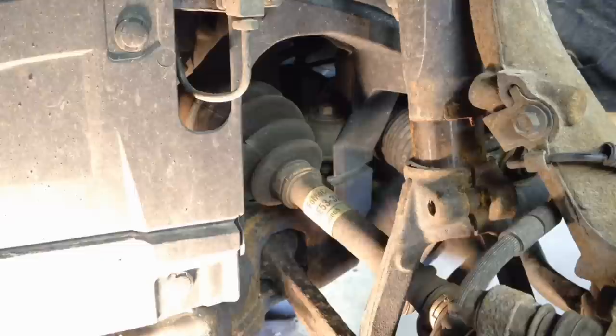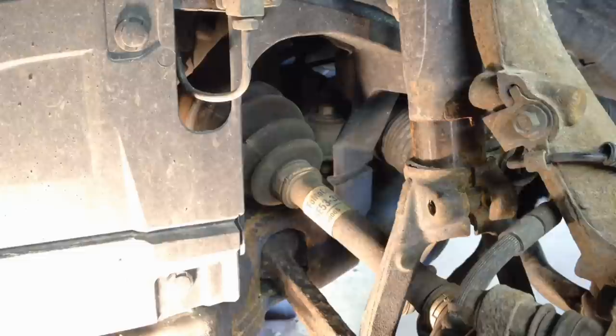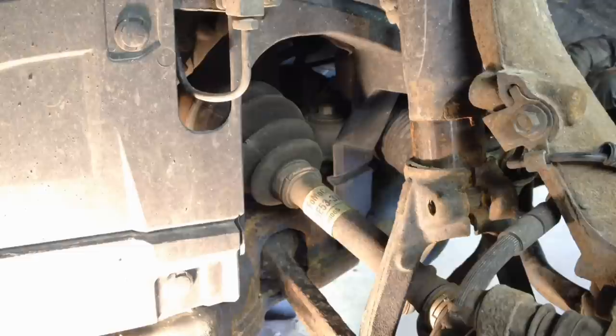What you don't wanna do is start pulling this stab link right here, the actual stabilizer bar link. Those ones have no holding feature to them, and the nuts on them get really rusted, and you'll be burning up your stab links. You'll be changing stab links next. There's no need for it.